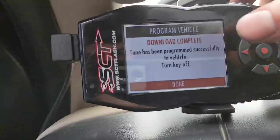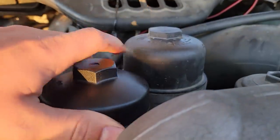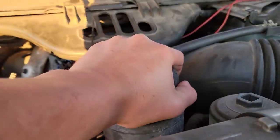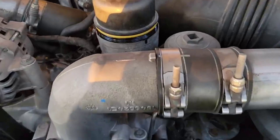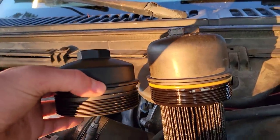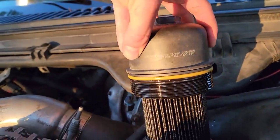As you can see, this oil filter cap is way bigger than this one. This is where it would sit — you can tell it's way higher, it doesn't push the filter all the way down into the filter housing. So it doesn't filter all the way — some of the oil gets by at the bottom because it's not pushed all the way down. Let's get this bad boy off and toss it, because this is bad, bad, bad. Look at this dirty boy — you can see the difference on these caps. Always make sure on your 6.0 you don't have this big stupid cap.